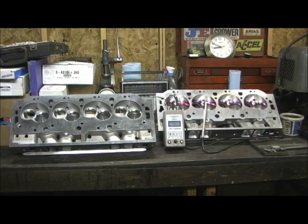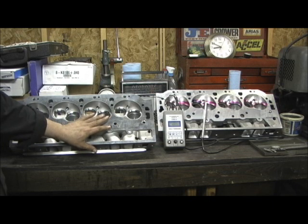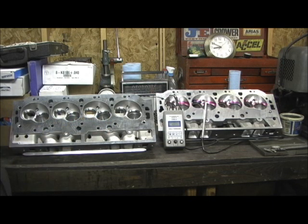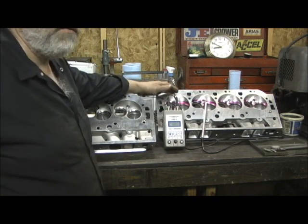Okay, what we're looking at here is a new wave of aluminum big block Chevrolet heads. These heads are sold in the U.S., I believe primarily, by a company called KMJ Performance out of Story City, Iowa. The ones on the left are their new Assault head, which is 345cc runner volume. The head on the right are a brand new pair of Dart 345 heads.